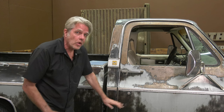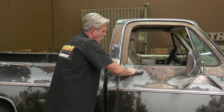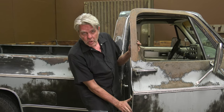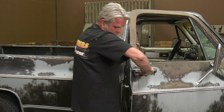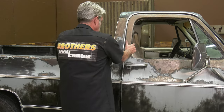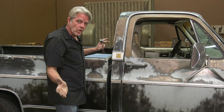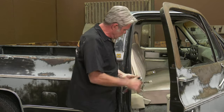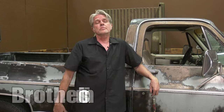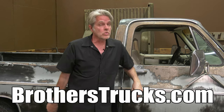If the door has sagged and every time you shut it the striker pulls it up, that's going to wear out the striker and everything else. Get the door in the right position first, then put in your striker, and simply shut the door to see if it encourages it to come up or go down, or if it's out too far or in too far. There should be two clicks when you do this — one, two — so if you only get one click, the striker is not in the right position. It'll just take a few tries to get it right. My name is David Welch — make sure you check us out on Facebook and Instagram and subscribe to the YouTube channel.